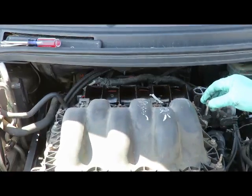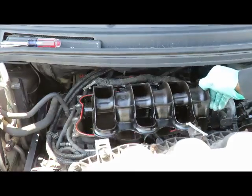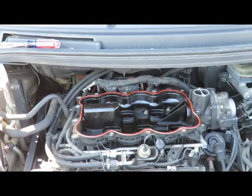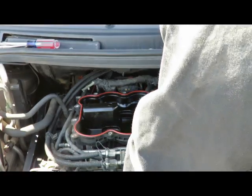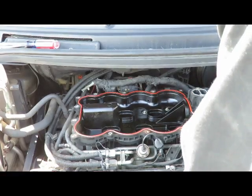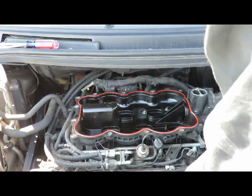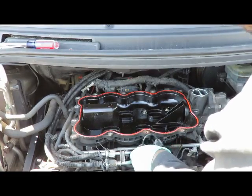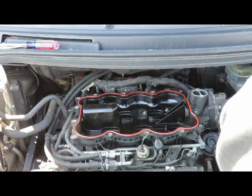The bolts in, I had to remove this one right here away from the idle air control mounting. Take this up. Set that to the side. Now, looks like on the inside of here, we got 8mm bolts. Yep. So, those 8 out of there, like the vacuum line right here, go to the fuel pressure regulator. So unplug that from right there.